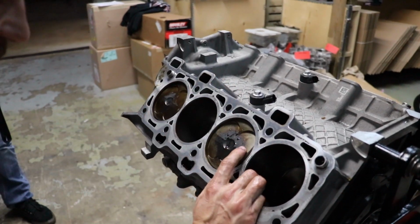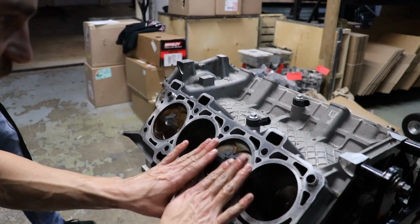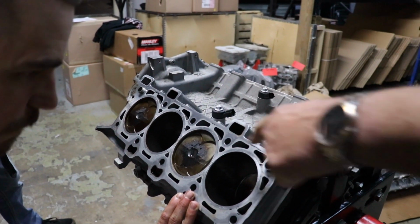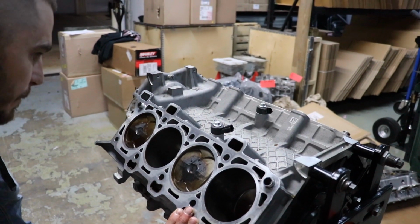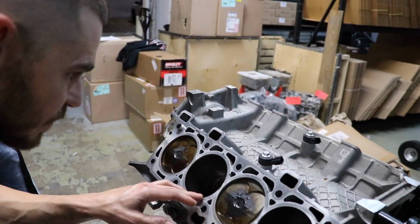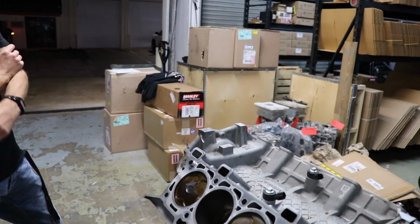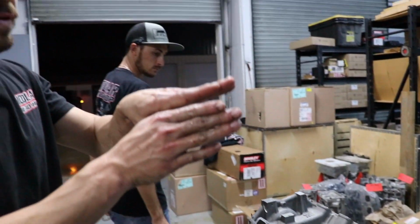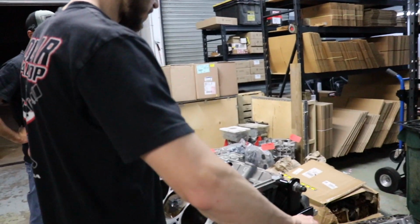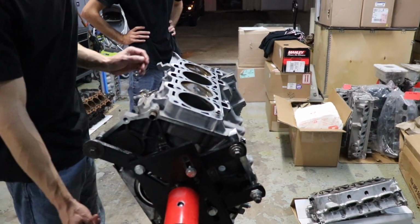It almost looks to me like this one's messed up too. Yeah. This piston is not sitting straight. No. Sitting like these two. These are the two cylinders that had the water in them. And actually, this one over here looks a little bowed up on the side too. That's the one I was thinking of at first glance. I'm thinking you're going to see ring lands lifted on at least these two. Hopefully we can get these out. I mean, it is locked up solid.